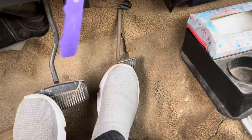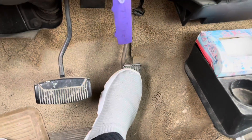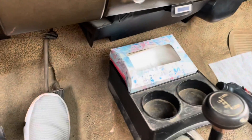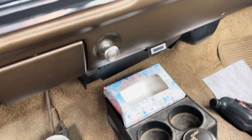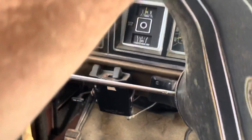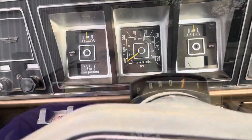You can hear it — it just doesn't seem happy. That, or it's just straight up flooding itself out. It may have to take the carburetor off. We'll let this thing run for a while; I don't know if it's going to be any good or not. Try to get rid of some of the gas out of it. See what happens. Hopefully it doesn't burn down.